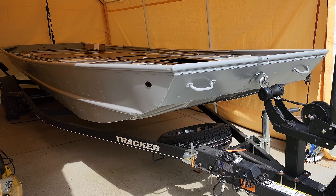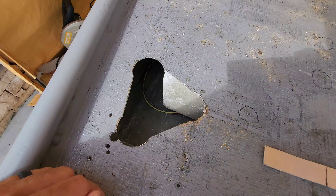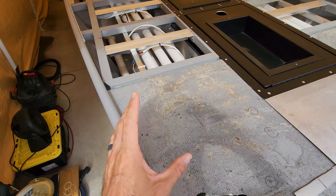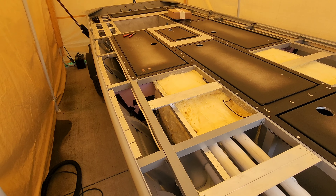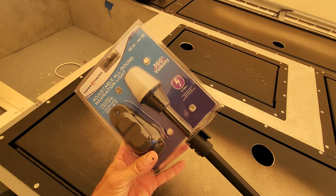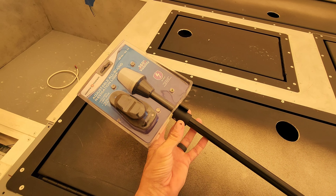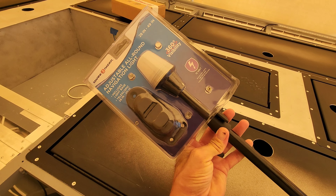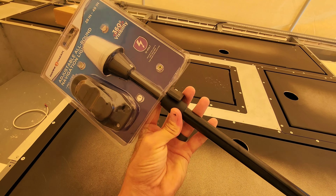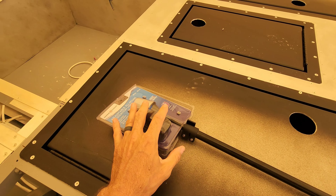Up front on this boat, I'm using Osnium LED Shark Eye nav lights. These things are awesome and super tiny. US Coast Guard two-mile visibility approved — legal. They're actually aluminum that's been powder coated, so not plastic — very high quality, not cheap, around $80. Super small, low profile, really cool. I had to cut into the deck to get through the foam, get them wired up on both sides, and it routes around — two into one — then feeds to the back.